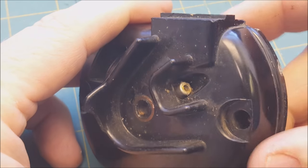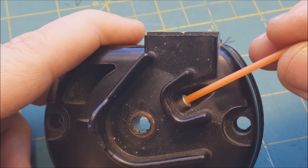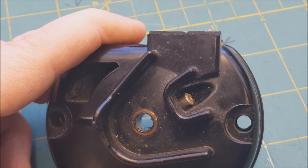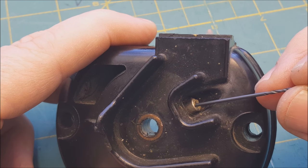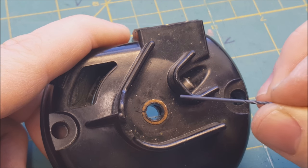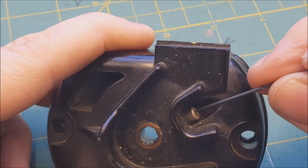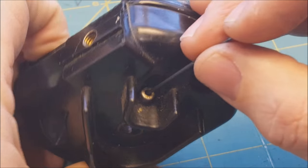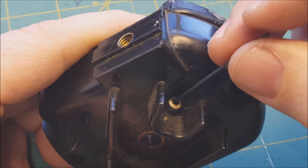Back to this one now — you've got two problems with this motor. It's really short, and this hole is too small to get the little straw tool in. So you resort to using an old needle or whatever, and that works to get some of it out. But usually with this particular motor, because it's such a small distance and definitely smaller around, the felt itself is smaller — these are quite often hard as a rock. I'm just barely inserting here and it's hard, it's solid, you can't get anything cleaned out of it. So there's no place to put the new lubricant.